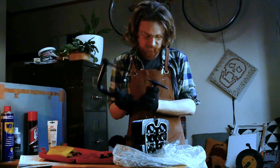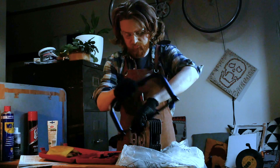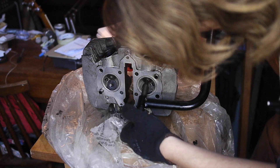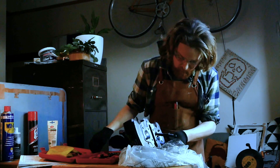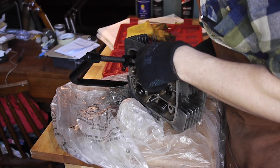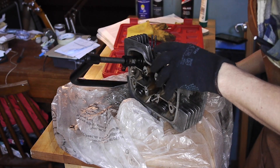With it together like that, we can put this piece over the valve spring. This piece will come up against the valve itself to stop it from opening — just like that. And I'll be getting the bar and just tightening that one up to compress the spring. And we're going to see two little halves of a thing — I've forgotten the name — that stops the spring from firing off the end of the valve.